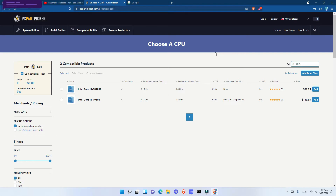Second, when your GPU is under 100% mining load, it cannot simultaneously provide a stable video output for the operating system. If you also try to overclock that GPU while using it for display output, the system will be unstable and crash constantly. I tried this with the i3-10100F, as shown in my previous video, and I won't do that again. I'll just pay an extra $20 to get a CPU with integrated graphics for a stable, well-airflowed system.